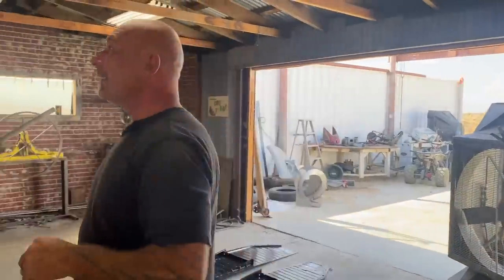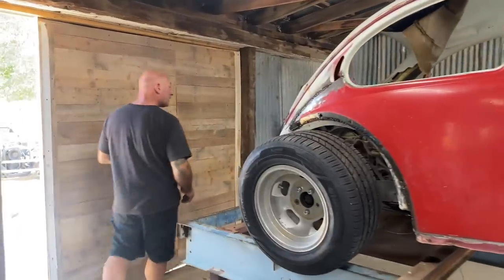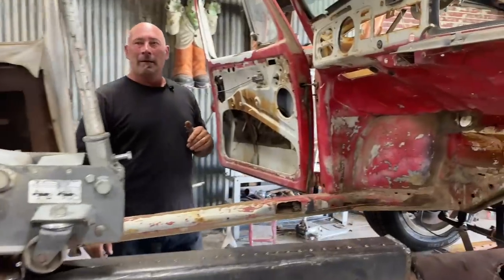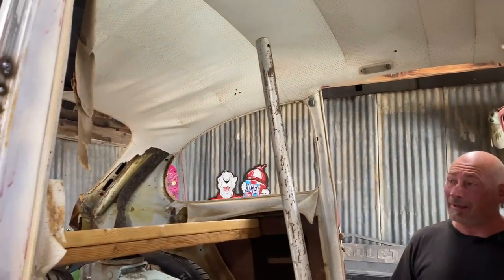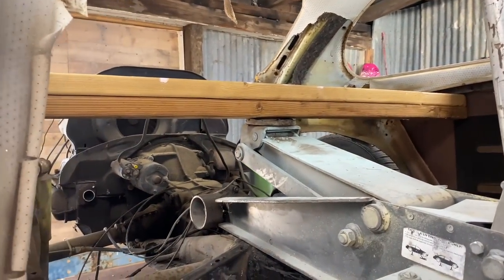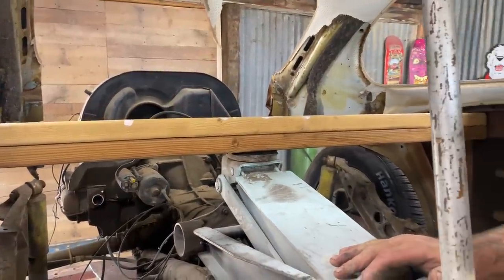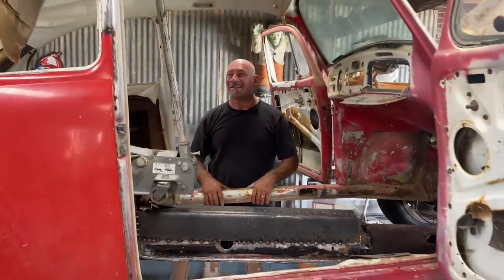Here it is on the table - take a look inside. The car is very tippy so we're not gonna touch it. So this is the old floor jack in the car technique to lift it up, then we're gonna do floor pans. I went in last night and cut out all of the seat and package tray area because the rear of the chassis lifted up six inches, so the engine's hitting where the back window is. I cleared it all out, got a floor jack under the front - you can see it's perfectly balanced.